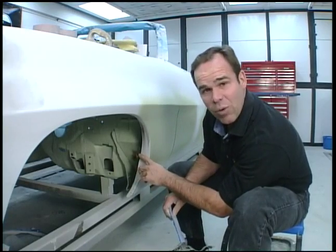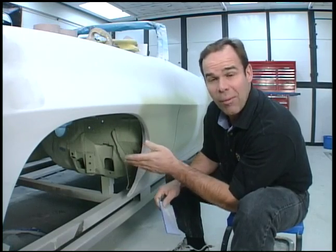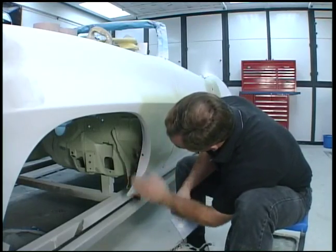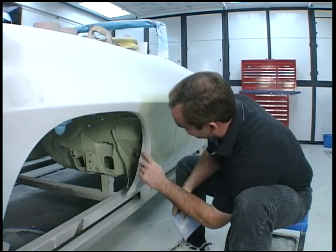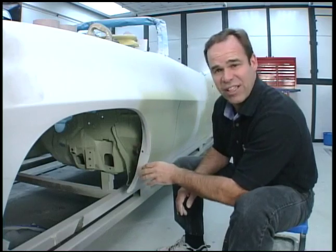You can see we've still got a little low spot here. If this is painted with metallic, that's going to show up. A lot of guys really don't care in the wheel well, but if we're going to do it, you may as well do it right. Guide coat all the areas, sand all the areas. This conforms nicely — you've got a nice smooth finish here. You've still got a couple of low spots there, so you keep working it. When all the guide coat's gone, it's perfect.